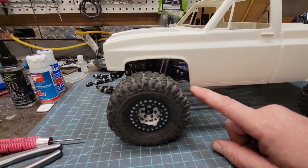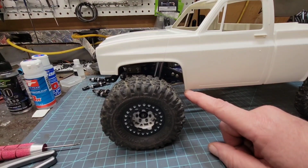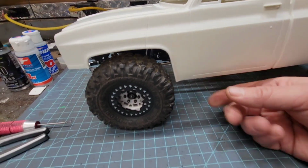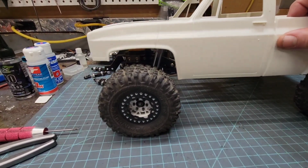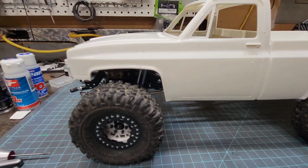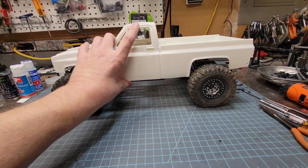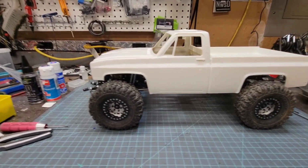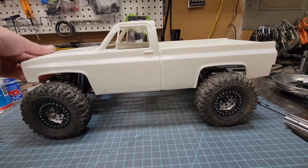You're not allowed to cut behind the front wheel well, except trim, molding, and flare. So I got about, I don't know, 1/8 of an inch that I'm going to need to nip here. Just the flare. Just take the flare out, and you should still be, quote unquote, comp legal for SORCA. We run SORCA rules up here in our comp, so I want to try to stick with that. And in the event someday that I am able to go to Scale Nationals, I'll still be able to pass tech. So just kind of try to build by the rules.